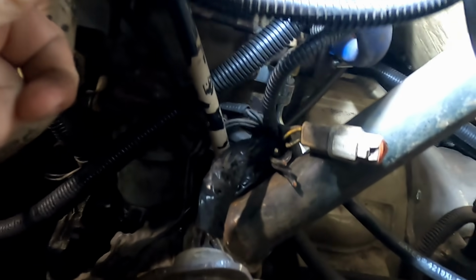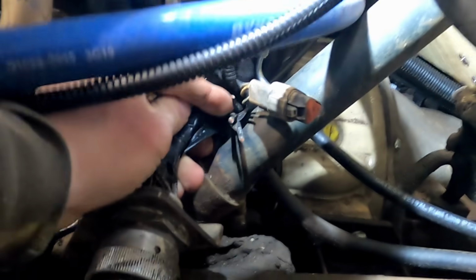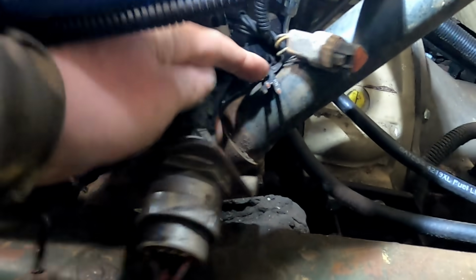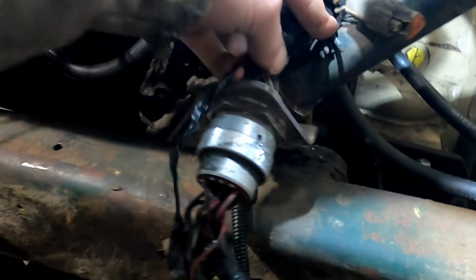Finally, the aha moment we've been looking for. I start just unpeeling tape, and what do we find? Some freshly chopped off wires, one of which has continuity back to our hot pin on the VP44 plug. So that's our relay.